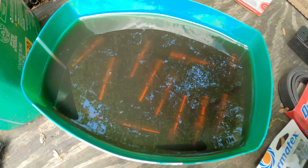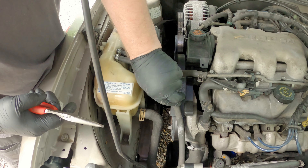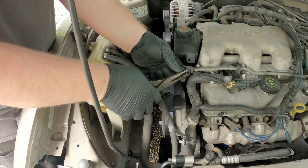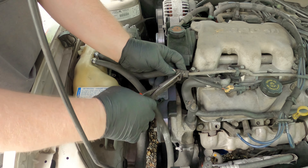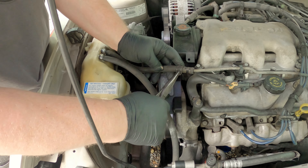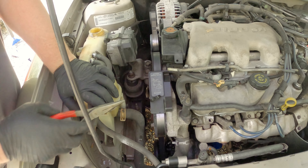All the lifters are soaking - they were bubbling some air out a minute ago but they've mostly stopped. I'm just going to let them soak there until we're ready to put them in the engine. Next we're going to get these coolant hoses out of the way. This one we can just push over here to give a little more room. This one we will disconnect because it attaches to this tube that attaches to the thermostat housing - it hasn't been off in a long time. Bend the tabs back so you can squeeze it more open and they come off easier, then just grab and twist a little bit and it comes right off. We'll tuck this over here out of the way.